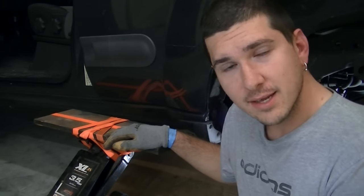It would appear that there is a power connector that goes into the fuel pump. Unfortunately I won't be able to get a camera back there, but that absolutely needs to be removed before dropping the tank — it appears I was pulling on it as I dropped the tank. So remove that before lowering the tank any further. I was able to get the electrical clip off of the fuel pump, so we're going to continue to drop the tank.